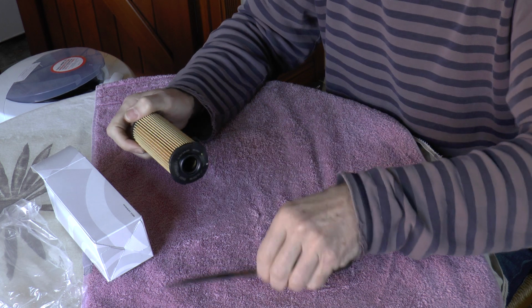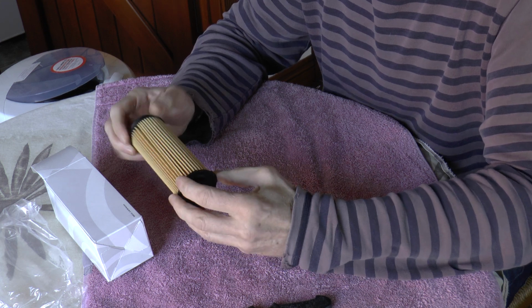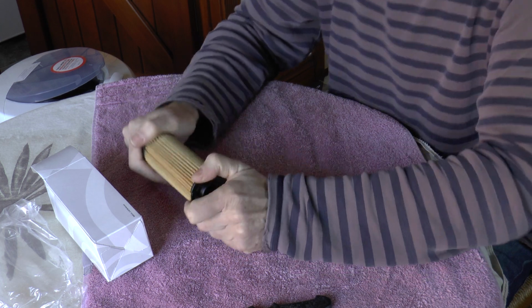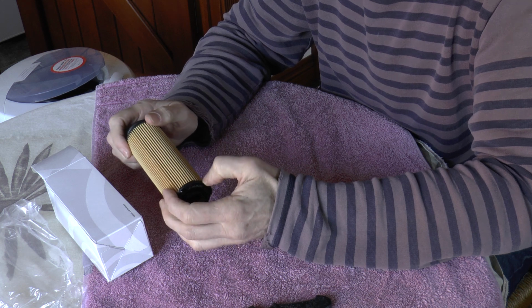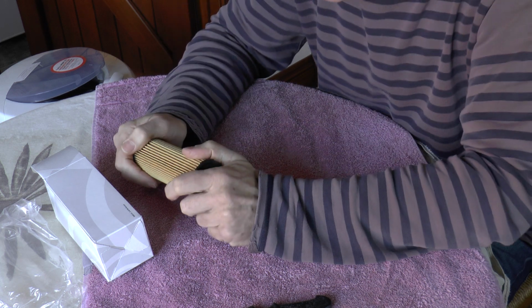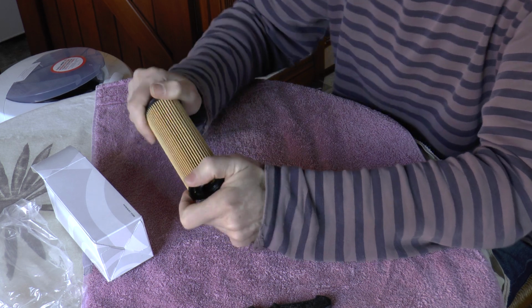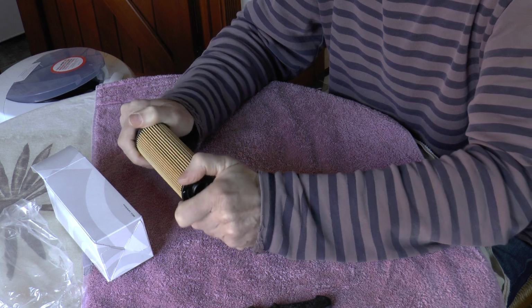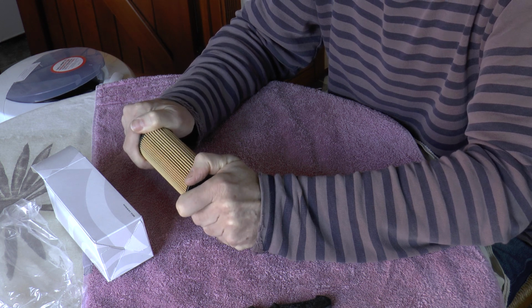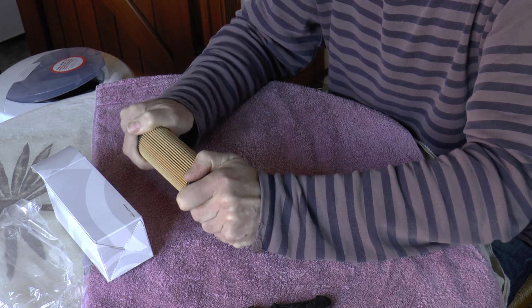Right, but hey ho. Okay, so the first test. I did say in my previous video that prior to installing the filter, it wouldn't be a bad idea to make sure that the two ends were locked in place, in other words that it had been assembled correctly, and to do so by twisting it. It occurred to me subsequently that, although that's pertinent advice, people might give it a real good twisting and of course damage it, and then install it in their cars only to have it disintegrate when they removed it. So if you do test to see if the ends are locked by twisting it, do it pretty gently, obviously, and if you hear any unexpected grindings or graunches or there's any movement, then for heaven's sake don't install it. Anyway, that's a gentle twist and I'm not getting any movement.